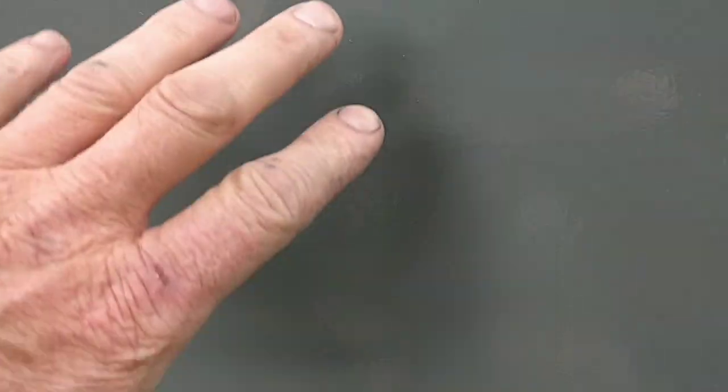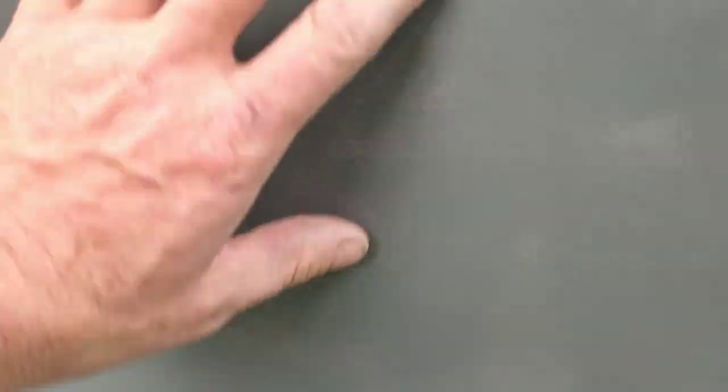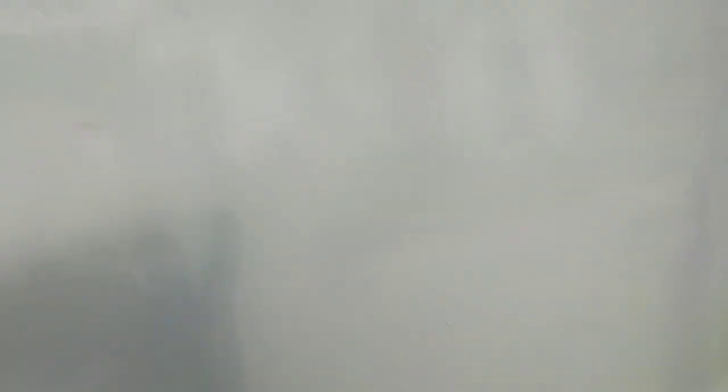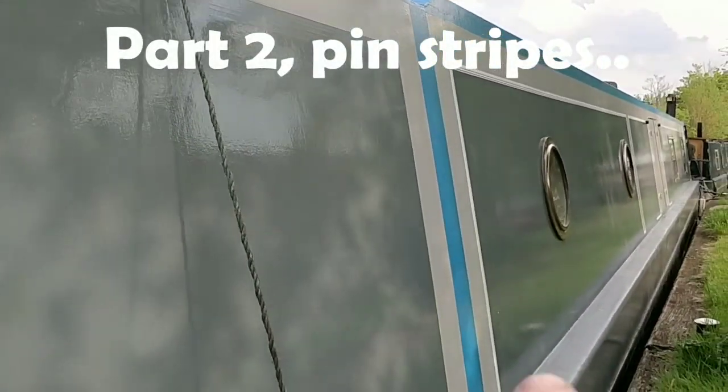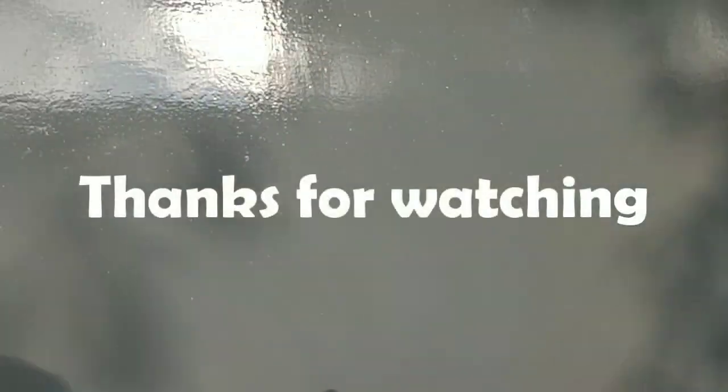Now this paintwork — you can see the finish in there, see the shine on it. It's touch dry but this paint stays very very soft for three or four days. You can see the reflection in it — there you go. That took me all of 20 minutes just to paint that section. Sanding it down was about 20 minutes, masking it off about 10 minutes. I've still got to put the pinstriping on yet, but that's it.